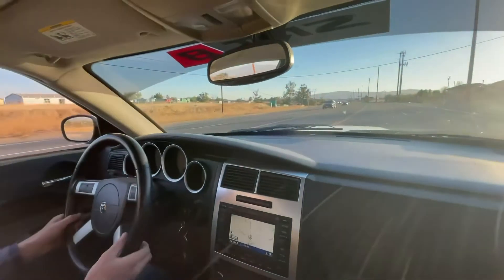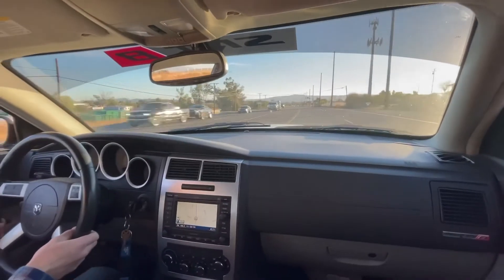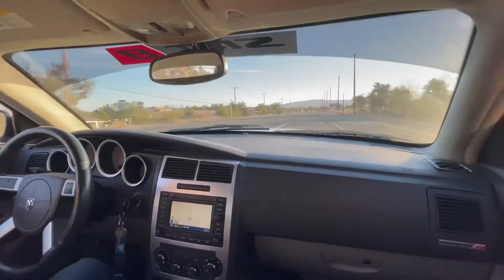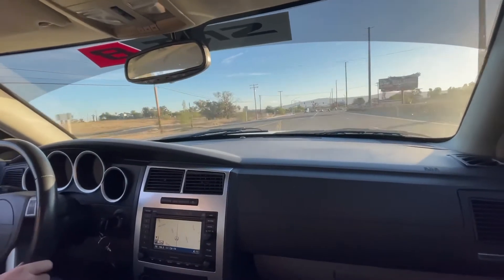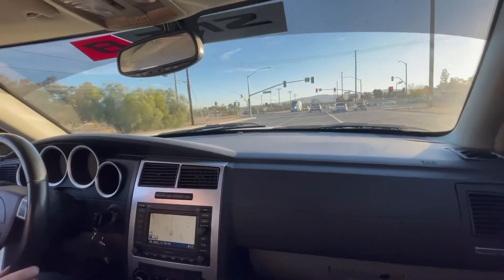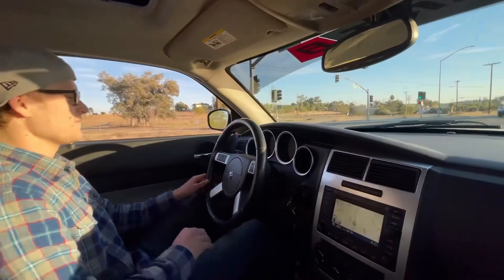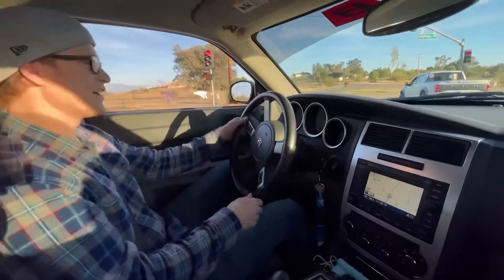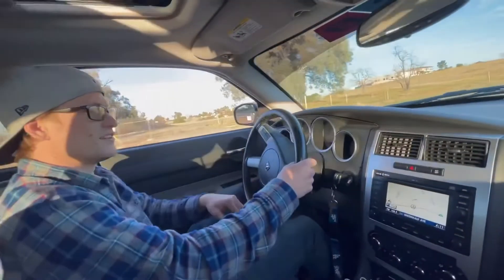It's a 30 roll — 25 actually. It's got a lot of torque and it just feels like it keeps picking up speed at the top end. It still needs a custom tune. It's still on the Diablo 91 tune, but it doesn't know what's going on because there's no cats and the rear O2s are not in — they're just hanging there.